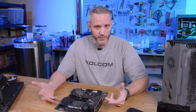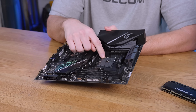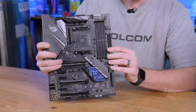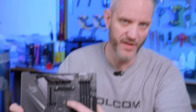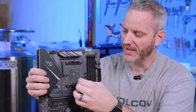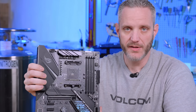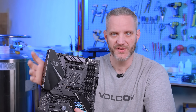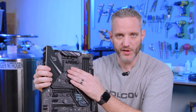Things you can install on your motherboard before putting it in the case: the CPU, obviously. AMD CPUs are pretty easy to line up. A side tip — don't get thermal paste in your socket. AMD has the easiest CPU to install because the pins are on the CPU itself. Intel LGA sockets tend to freak people out because they're more delicate — the pins are on the motherboard, not the CPU. So installing your CPU first is usually the very first step.